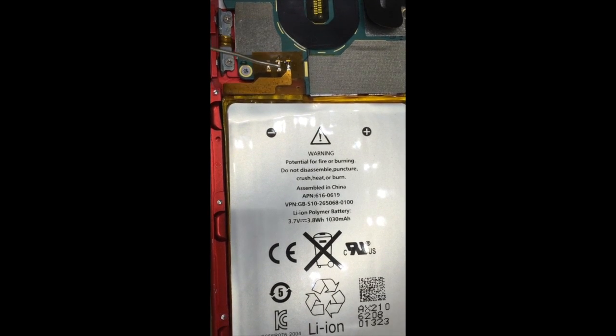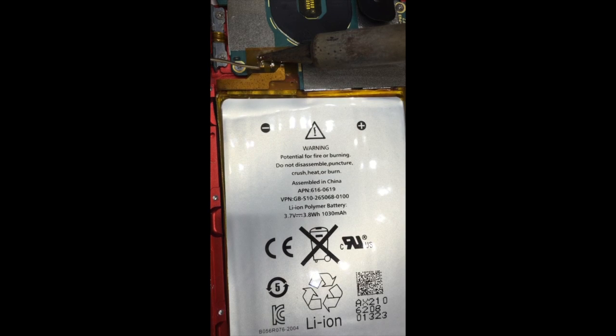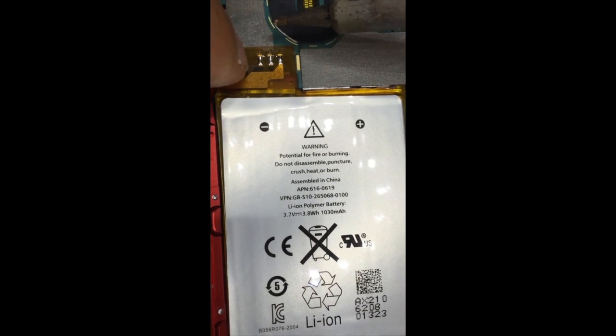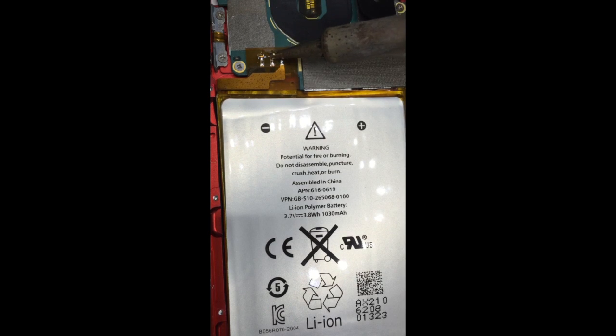Okay. And of course there's solder on the bottom, so that will help on that path too. And solder is used as more of a clamp than an adhesive. If you're going to solder two wires together, you wrap the wire around each other, then you solder over that, which clamps it together more. So it's used more as a clamp than an adhesive, which you would put between wires or between circuit boards.